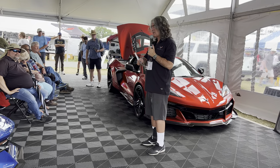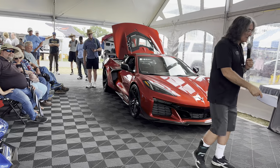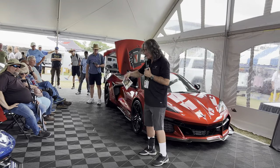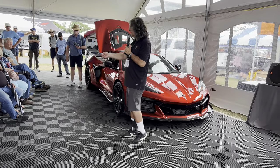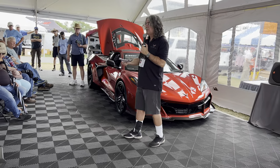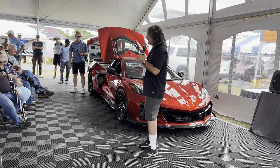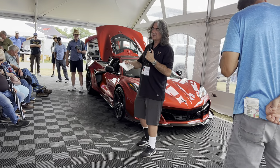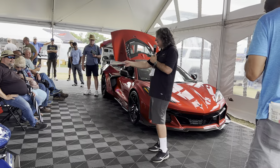There's been a lot of dialogue about the stone guard that is now available as an option on the display here. I want to explain the radiators at the front: technically what you see when you look at the front end of the car — those aren't actually radiators on the left and right side, those are condensers. The radiators are behind them. Radiators are made out of very thin metal called folded tube technology — we roll the tubes over and braze them. The material is ten thousandths of an inch thick aluminum, very soft. Those radiators are never designed to see the first air; the condensers are always designed to go in front of them.